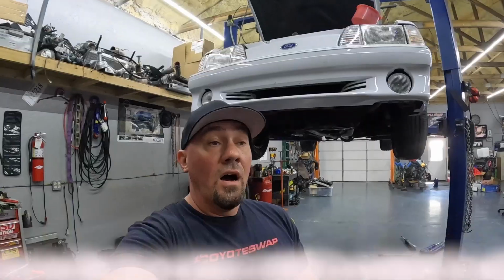We're almost there. All right, so the plan was we were gonna drive it and do the first fire all in one video. The H pipe's gonna have to come back off, and it's not sealing to the headers good, no matter how tight we get it. I'm gonna have to pull that back off. Brand new power steering line is pouring fluid, but other than that, we're good. So I'm gonna end it here.